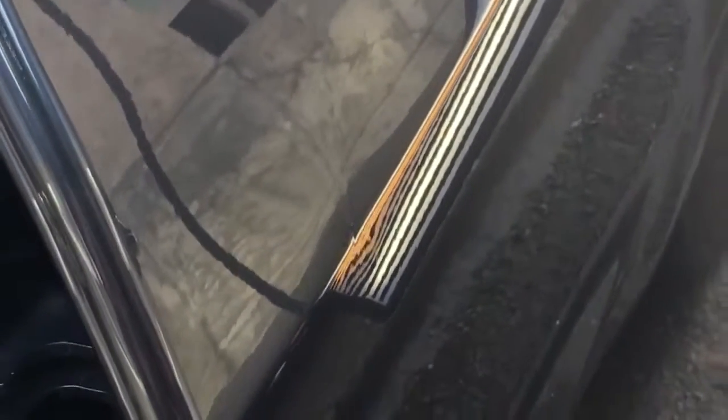And I'm just in that same spot. I can't even remove my hand to show you where I'm at. So I'm right where I needed to push right there. That straightened out that line. And now I'm just kind of chasing it up. I'm still gonna have to make some taps. But that's what I wanted right there, guys. Cleaning up that top of the line. I'll come back down and get right into the body line in the middle and clean that body line up.